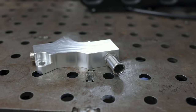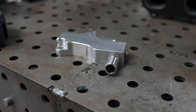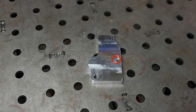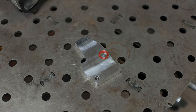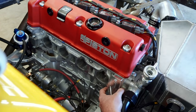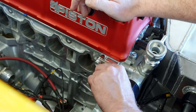We're not running a thermostat though, because we have an electric water pump, and so running this fitting is more or less useless. We could cap it, but I'm not really happy with that kind of bootleg solution. So instead, I turned to TrackTuff for their block-off plate. Rob at TrackTuff was really helpful in confirming that I could indeed block off this port without any ill effects. It's close enough to the water outlet on the cylinder head that it shouldn't cause any issues, and thankfully this is easily reversible if I want to change it in the future. I had to machine a little spacer due to some differences in how this is installed, but job done.